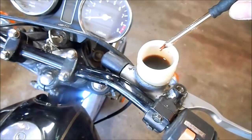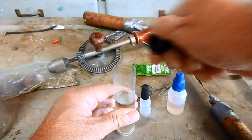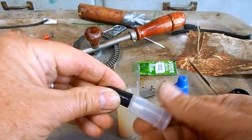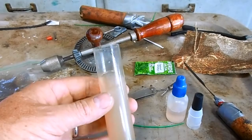Now for an accurate test, you need 7 milliliters of brake fluid. Then add the brake fluid sample to the test kit, and add 4 drops of Part A, then add 1 drop of Part B. So if it turns green, the fluid's good, and if it's red, the fluid's bad. Just put the cap back on and shake it for about a minute.